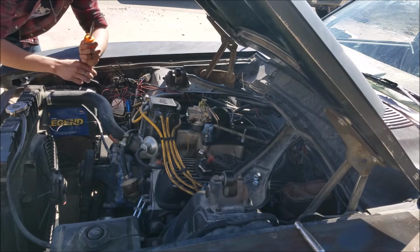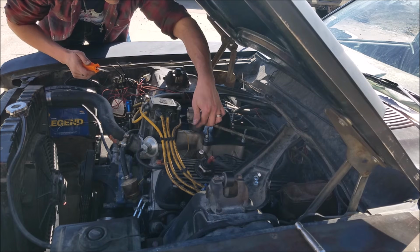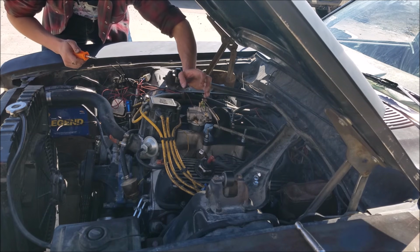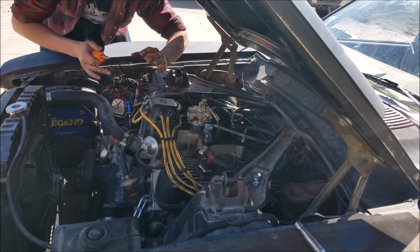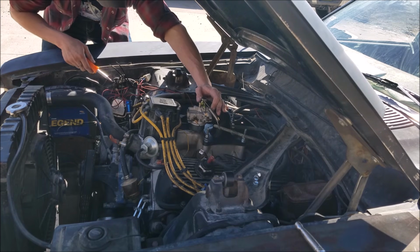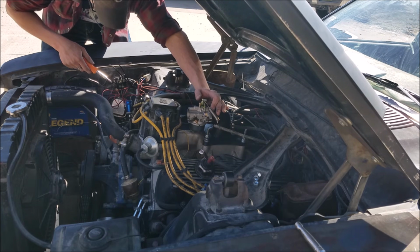So what I think I'm going to do is I'm going to actually have to try. We're not going to do the shaky hand 1000 like I'm doing right now. We're going to get the tripod, and I'm going to just jump the starter and try and work the throttle and see what happens. We have our under hood key, and then we just flip the choke. In theory, I have these pretty far out, but not all the way out, so it's not just runaway rich, if it could be rich. But we'll just listen and smell and see what we have and adjust as we need.